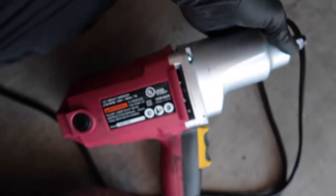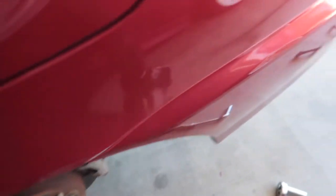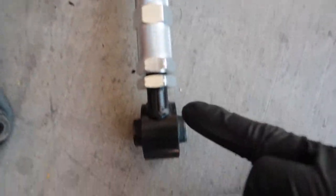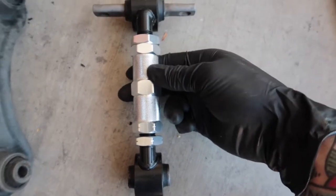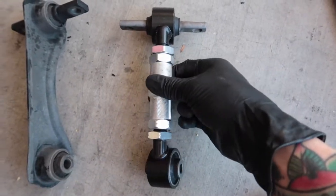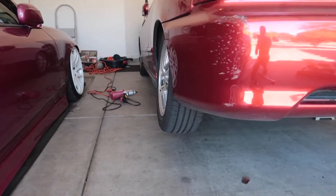There are just two 14-millimeter bolts — one and two — and then a support bolt here, also 14mm. This impact drill works wonders, 10 out of 10 would recommend. Got the first camber arm in, I can already tell it's leaning nicely. Usually on a toe arm or camber arm, you give it equal thread on each side, and when it's time to adjust you break the locking nuts free and adjust the middle section. Right now it's pulling inward, and if you adjust the other way it pulls outward — makes it a lot easier to dial in.